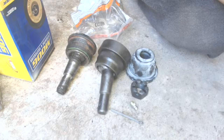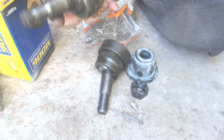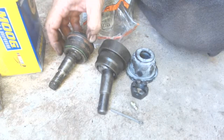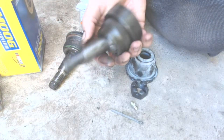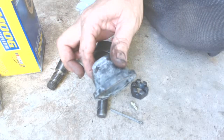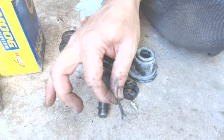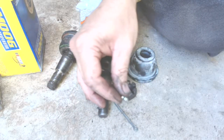Here's a comparison between the old ball joints and the new ones. The old ball joints are extremely loose in their bores, while the new ball joints are very tight. I had to use a bench vise to straighten the shaft so it would align with the press. The new joints also came with the required parts including the zerk fitting.